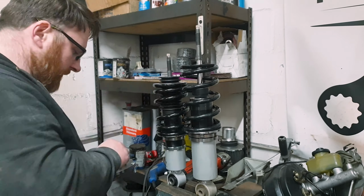So that's the disc that came off the car, and that's the disc that came off the red one. So nice, obvious upgrade. And the upgrade is quite simple because all I actually need to do is put the carriers from the red one on and the calipers are the same, discs on, and away we go. So I took the disc off and obviously the dirt guard needs to be chopped and mangled a wee bit just to get the bigger disc on.